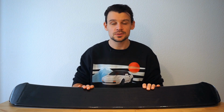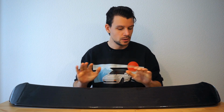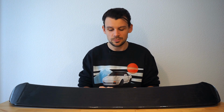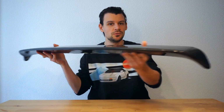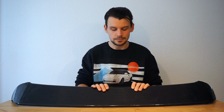Mistake number 5 is the wrong part. Why the wrong part? Especially when you start doing carbon fiber lamination, use a part with one visible side. It's a lot easier, because then you have one side where you can have some teardrops of the resin, where you can sand a little bit at the edge. That's no problem. But this was a wrong part for me because I have 2 visible sides, or maybe 4, depending on how you define it.